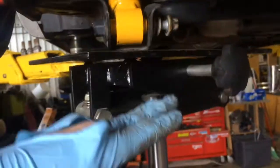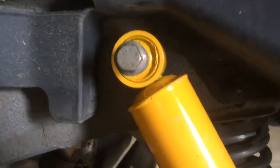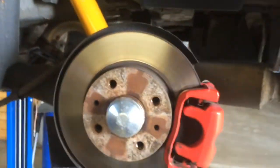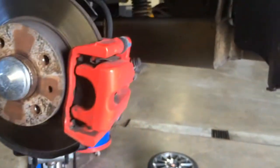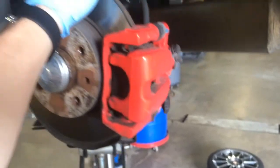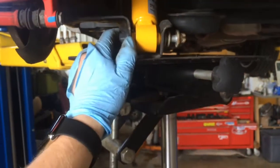If you're doing this on a driveway with jack stands, use a hydraulic floor jack — just really slowly. Jack it up with the lower bolt in but not tightened, and you will eventually get it up to the point where you can thread the upper bolt in as well. Once they're hand-threaded, before you decompress it, tighten them down. Ideally this puts a lot less stress on the bushing if you tighten it down when the suspension is near its compressed geometry. If you let it down and tighten it at the bottom, you'd get a lot more premature bushing wear — you might only get 10,000 to 15,000 miles out of a set of shock bushings if it's constantly twisting. Whereas these will be tightened at the car's sitting location at all times.